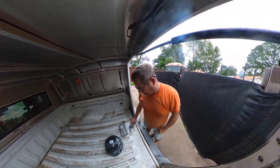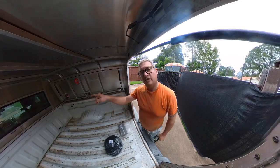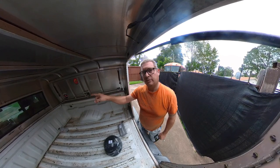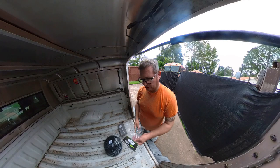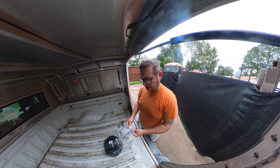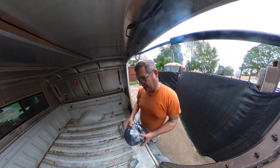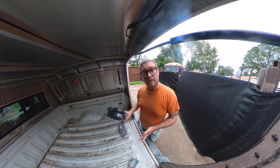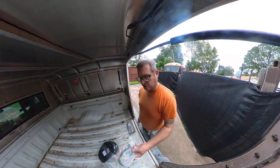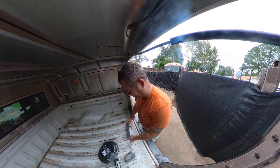Okay, so the first thing you need is, if you have a radio that has XM satellite service, then you've got the right radio. It can support a backup camera, is what I'm told, and you need this Axis integrated wiring harness. What this wiring harness does is it brings out the pins for the camera to connect to. You're going to need some kind of wire loom to protect the wires from the underside of the road. I bought this on eBay, cheap. I want to say it was $17 or $20. I don't know, it wasn't much.